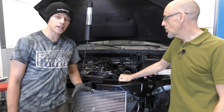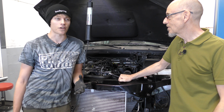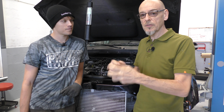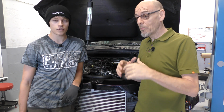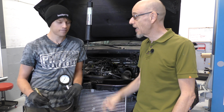No, so we think we changed the engine and took it to a mechanic who killed it, taking the head off for no reason. But as soon as you say to someone, I've got bubbles in my coolant, they go, oh, your head gasket's blown, your head's cracked. It isn't. Not necessarily, I mean, it could be. It could be, but at this stage it isn't. But you need a compression test. If you have bubbles in your coolant, get a compression test. Get it, or pay someone to get it done. Exactly right. That's our tip on this.